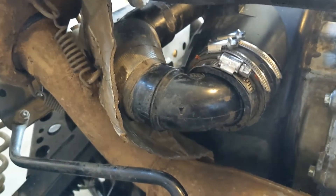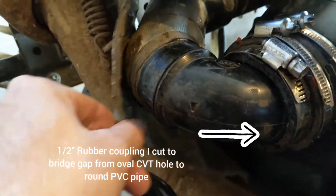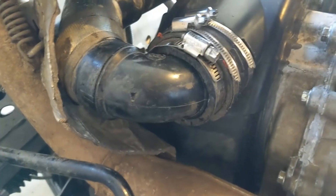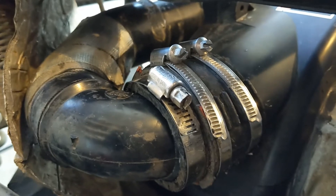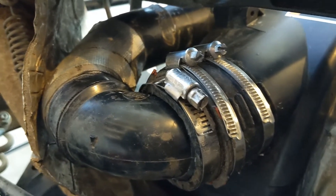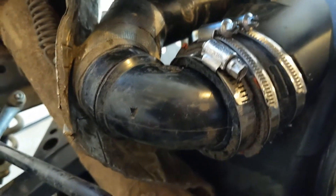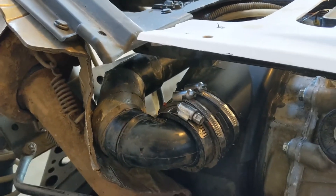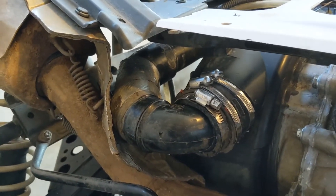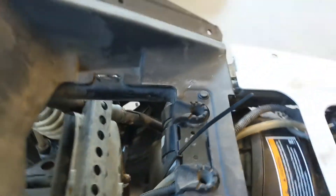Still on the right side here. This is also a pretty finicky area to get that 90 or 180 degree bend there with enough play between the exhaust and your pipe that you're not going to melt it. We've got the original rubber gasket there for the standard stock breather. And then I've got three clamps, which I've siliconed and clamped, and then done that 90 degree bend with some heat tape on the pipe as well. Just because it is such a tight bend there, I've zap strapped it up top so that it can't fall down and get close to the pipe.